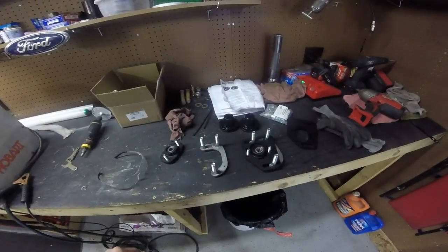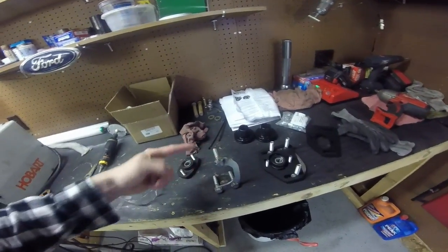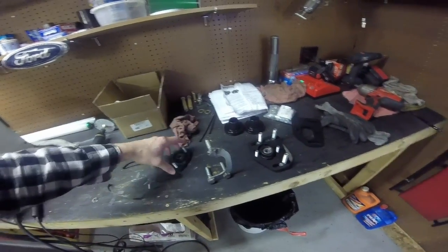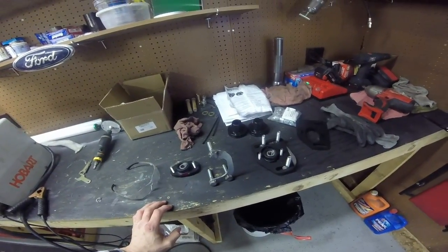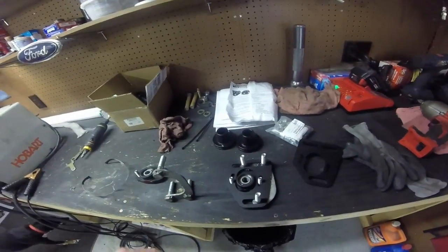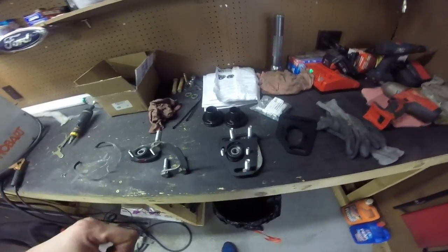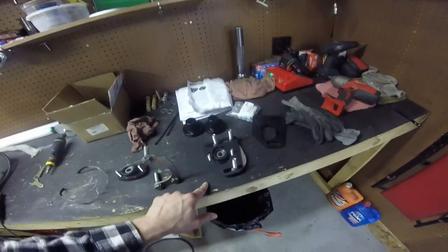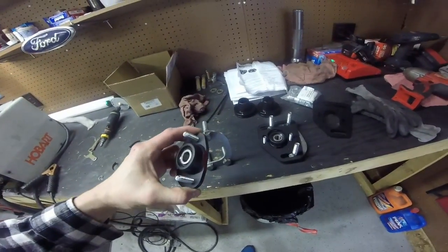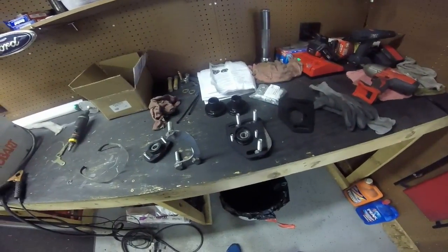Also, I took the Maxim Motorsports cam plates and these bolts were usually facing the other direction. According to Duncan's setup, that has to be done because otherwise this plate is in the wrong position. When you flip these plates from driver's side to passenger's side — the way Maxim Motorsports intended — since we need as much camber at the tower as we can get with the longer arms, this is what needs to happen. You just cut the welds off, flip them, and re-weld them. You can also grind that little portion off; it worked before, and this allows more caster, which is good for avoiding wheel flop.